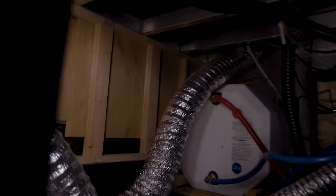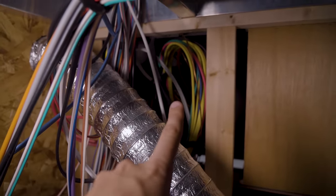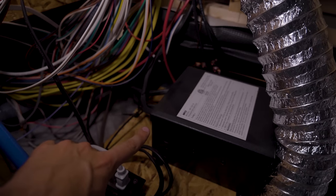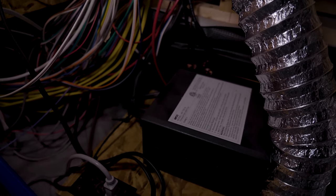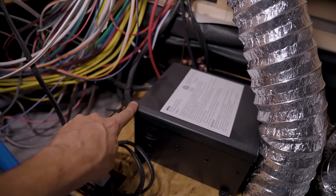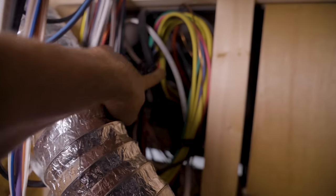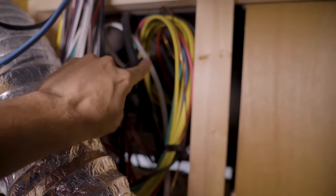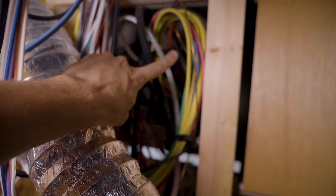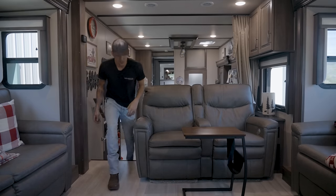I'm back here at the back of the 120-volt AC breaker box - it's really tight. Here is the back of the 120-volt AC distribution panel and here is the transfer switch. This is kind of weird because we don't have a generator, which is really the only time you see a transfer switch, but I suspect this trailer is just generator-ready - it's here in case somebody adds a built-in generator later. What is most important is this wire right here - the biggest wire going into the back of the breaker box - and this is what we're going to be splicing into to make all of our connections to our MultiPlus inverter charger, so we don't have to rewire our breaker box.